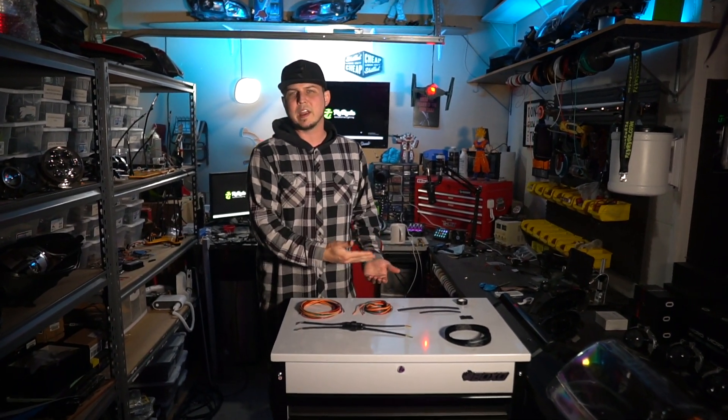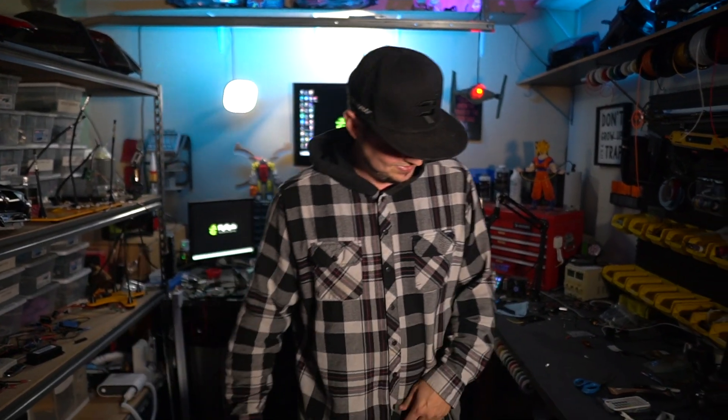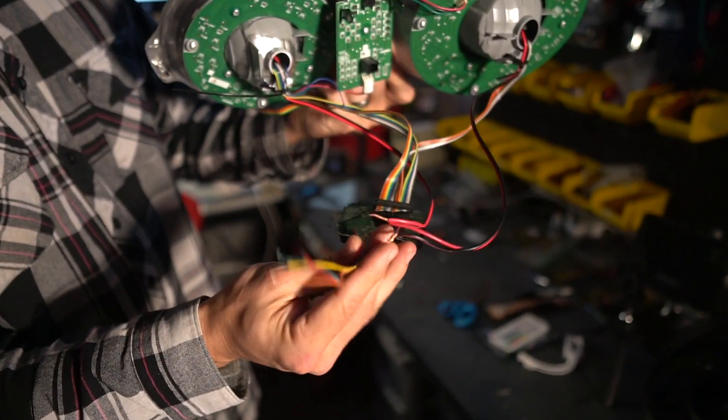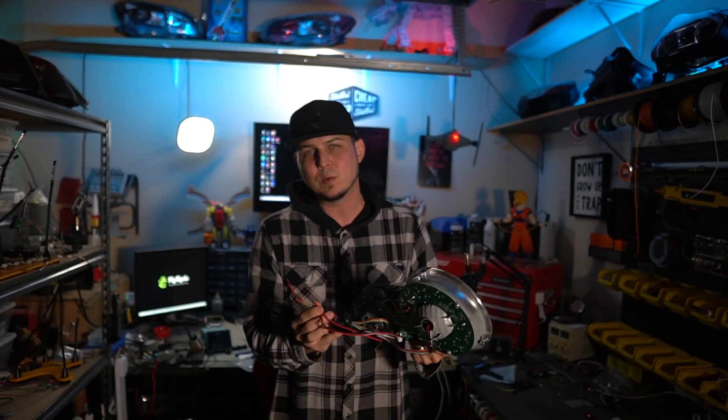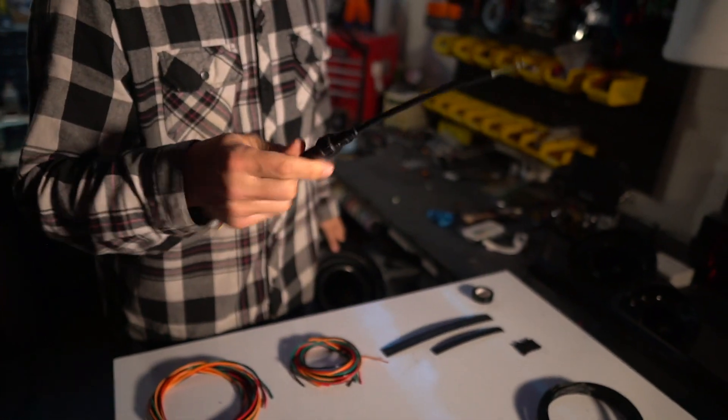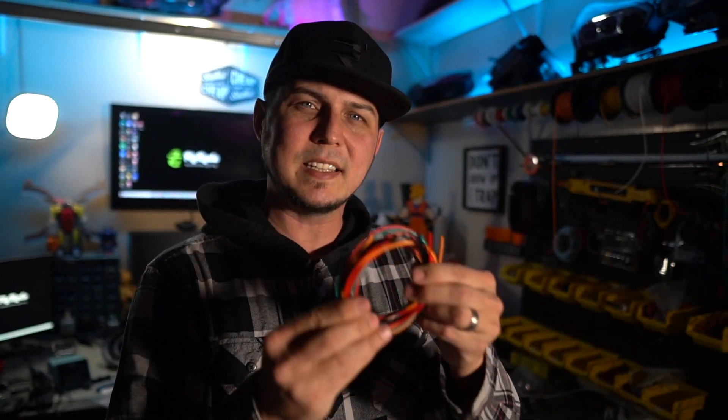Let me show you the components we have right here. We're going to use stuff that's a little bit different than what you'd see on something like engine management wiring or a full vehicle wire harness — we're not going to have to follow such strict standards. This is just going to get you from start to finish in as simple and short a time as possible. The reality is, if you look at a lot of custom lights being built, they have modules, they have all these extra wires — stuff that freaks people out. You don't want to see that coming out the back of the lights. So instead, we're going to be working with little connectors. I'll show you what that looks like in just a sec. I'm using basic 18-gauge wire here — this is not hardcore high-horsepower race engine management. We're just going to send 12 volts from one part of the car to another, and it doesn't have to carry a bunch of amps.